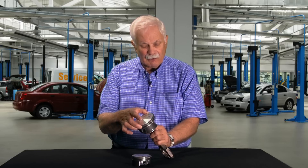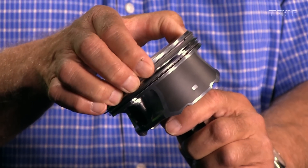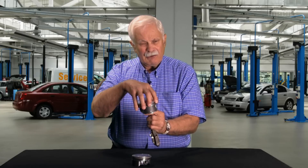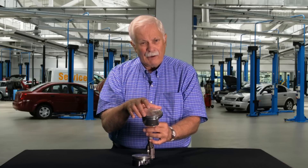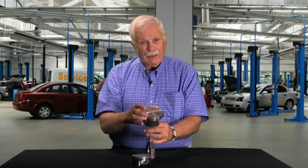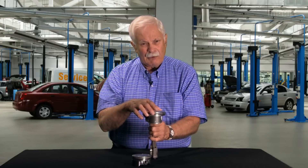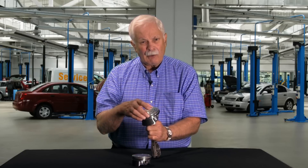When you look at a piston with the rings installed, or you look at a ring just in your hand, you'll notice that you can squeeze the ring and the gap on the end gets larger and smaller. When we compress these rings and slide the piston down in a bore, they need to get smaller to fit. The reason for the gap when installed is that as the engine gets hot and expands, the piston expands, the block expands, the ring expands — we need some gap to allow for this expansion and contraction. Hence, we have ring end gap.